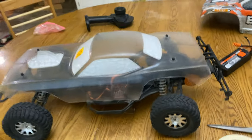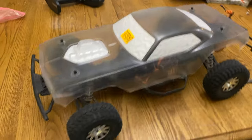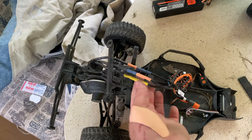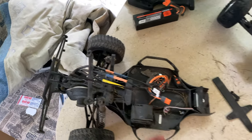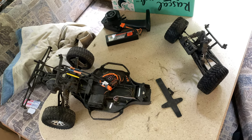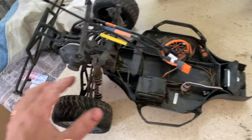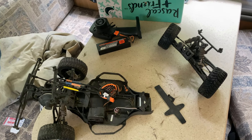Something happened. Initially it was stuck in reverse because the two wires — when I connected them color-matched — reverse would be forward gear. I switched it around and I'm pretty sure we were hitting 50-60 miles an hour at that point. On the last ride we hit a hydro pole at top speed, so it definitely shattered the chassis right in half. It also broke a steering linkage and the drivetrain seems a little out of whack, so we'll have to do an evaluation and see what is salvageable.